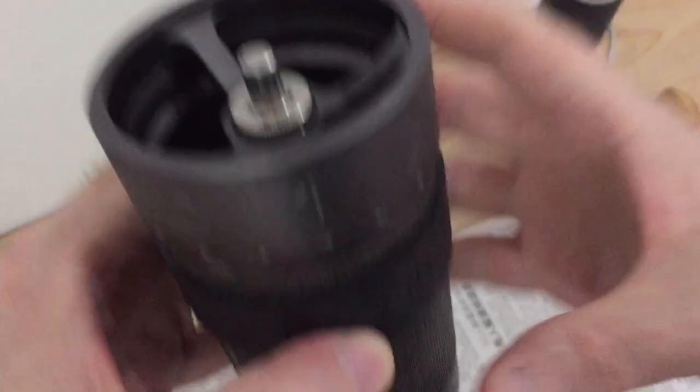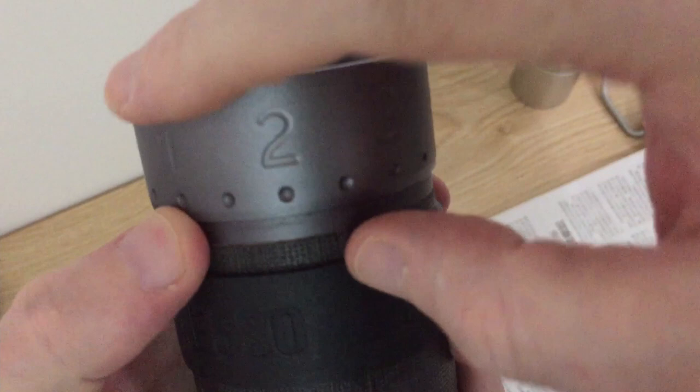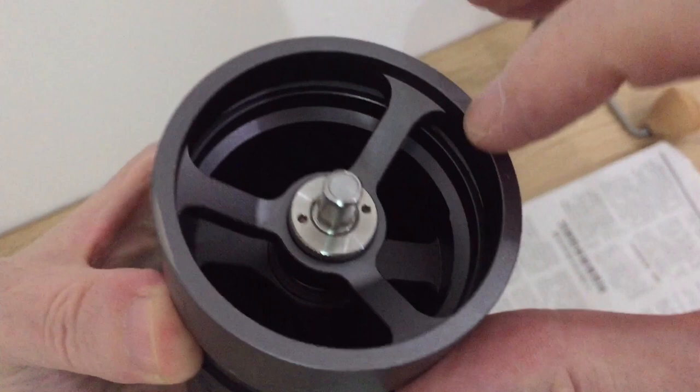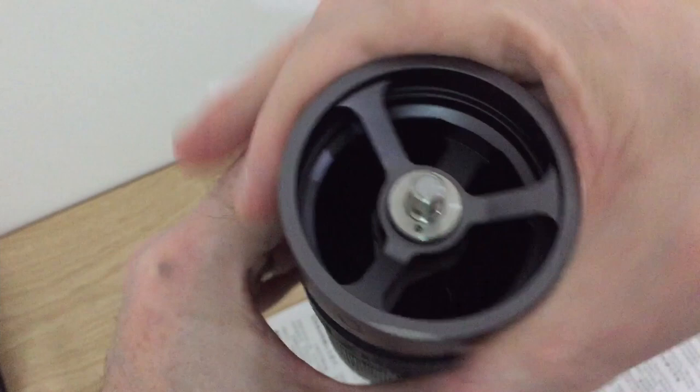If it's had an impact like that, it's going to have jumped the threads — one side goes down, the other side goes up. Just go counter to where the impact is. On this one it was here, and I just tapped that until I heard it click into place — it hasn't damaged the threads, it's just corrected it. Hopefully that's helpful. If you like this video please subscribe and give me a thumbs up — have a good weekend and take care.